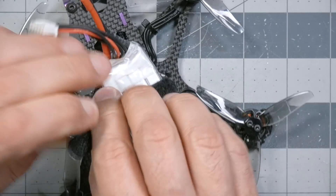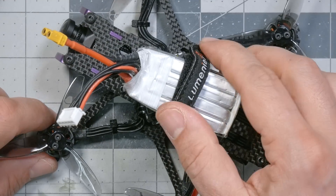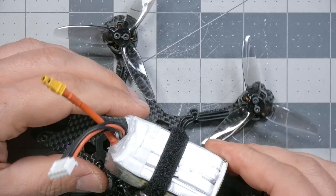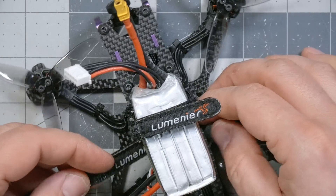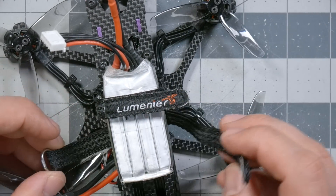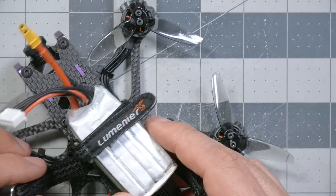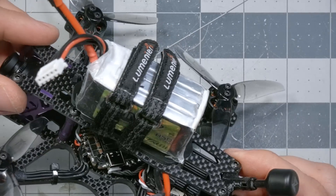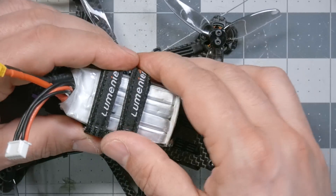The first mistake is only using one battery strap. Two battery straps are more than twice as strong as one — with one strap the battery can shift or lever itself out in a crash. We always want to run two battery straps. Push one toward the front and the other just a bit back. As you're passing the strap through, make sure you're not snagging any wires. This top plate has a little waistline intended for battery straps. We'd ideally like them spaced to the front and back of the battery, but we'll work with what we've got.